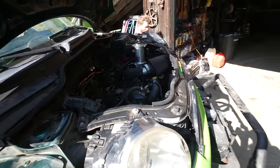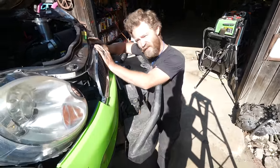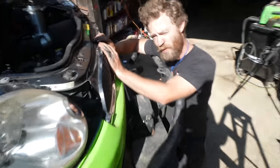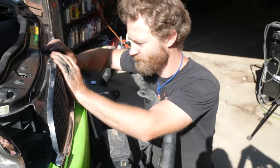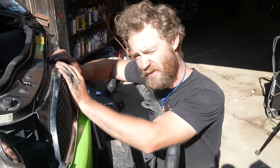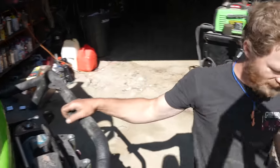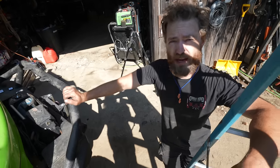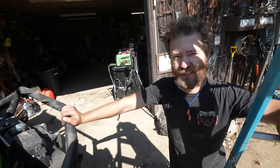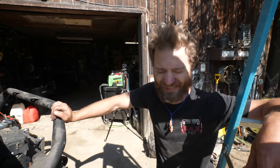Because I realized the way I set it up, the fan's going to stay on until that thermo switch cools off. Which may be a problem, because that might take a while, given that it's mounted not to the radiator. But I'll solve that problem later, because right now we're not going to be driving it that much. This was really just a momentary obsession that I couldn't let go of until I finished it.